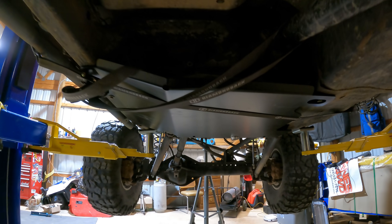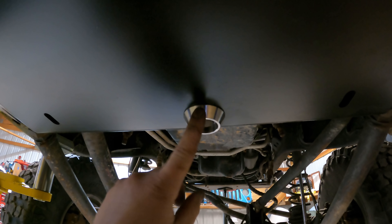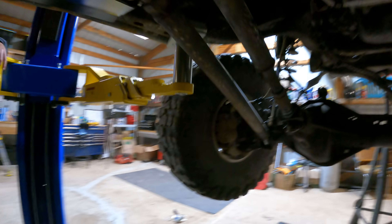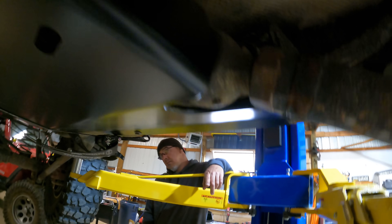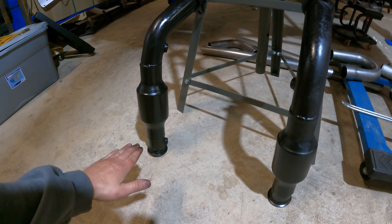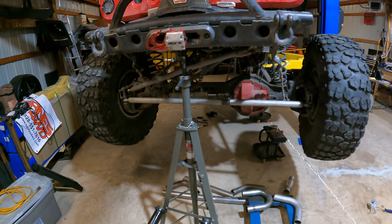We have the skid mocked up and painted - it looks really nice and well designed under here. We keep the factory bolt over here and our hardware, but we are going to have flag nuts up in the side of the cross member. Barnes gives us these bolt head protectors which are really neat. One thing I really like about this skid for my swap is that it incorporates into the cross member tie-in all over, which reinforces the cross member. My links are built into the cross member so pretty much all the stress is on that factory bracket up top which is pretty thin, so by tying this 3/16 skid plate to it it definitely beefs up that mount. Mike and I went ahead and took off the old down pipes with the cats, chopped it off since we're rerouting it, and welded V-bands on. We put some high-temp paint on there just to keep it looking nice before throwing those exhaust bolts on.